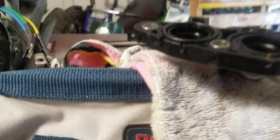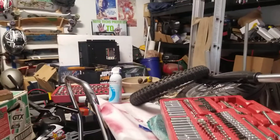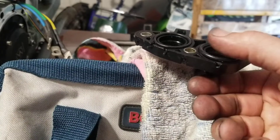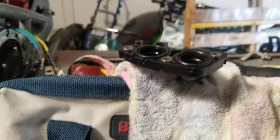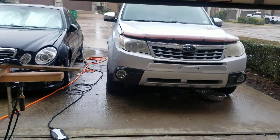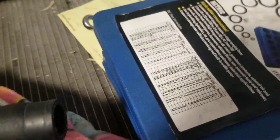So since they didn't have it, I got some O-rings and put them on this aluminum pipe, which is back in the spot where it's supposed to be, and then hit them on a belt sander until I got them small enough to fit. Since it's $78 to get that O-ring from the dealer, I'm gonna try it out and see how it works. I mean, they should work — it's good stuff, I've used them a hundred times.